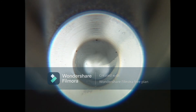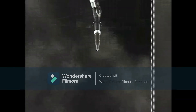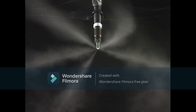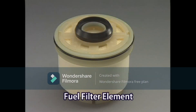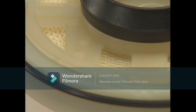To achieve this, the diameter of the injection holes at the end of the injector is approximately 0.14 millimeters — about the same as a human hair. Because these injection holes are so small, it is essential that clean fuel be supplied to prevent clogging at the point of injection. If foreign matter is mixed in with the fuel, it will clog the nozzle and the full potential of the high performance common rail will not be realized. Therefore, a new high performance fuel filter has been developed for the D4D to make sure that clean fuel is supplied to the injectors.